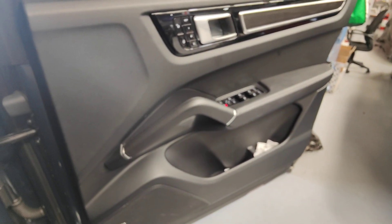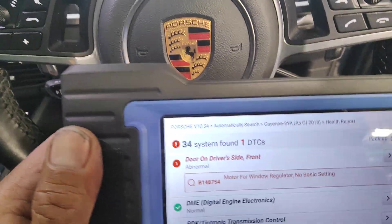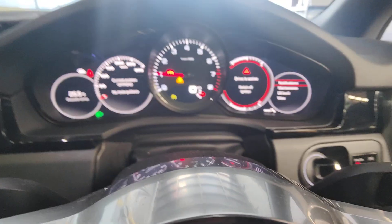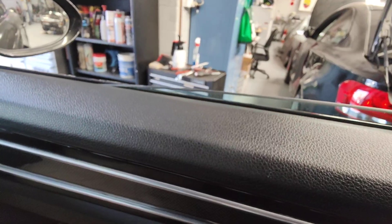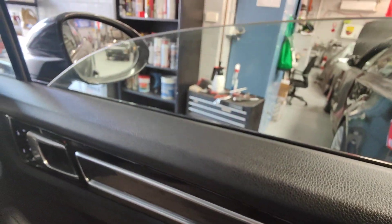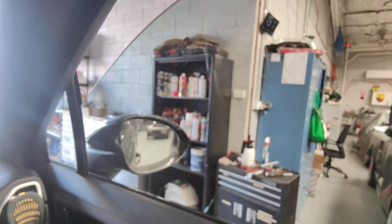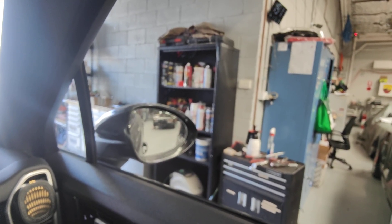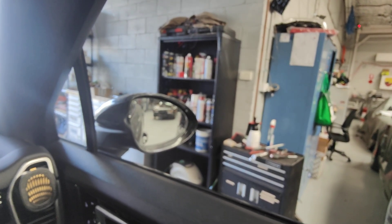It's pretty much: switch, hold it up for five seconds, hold it down five seconds, and the window goes down. Let's close the door. I've got only one fault — let's do that one. Go back in here, close the door. Now I'm going to go all the way up, hold it there for five seconds, let go, five seconds, and then it should come down by itself. See, now it's working.